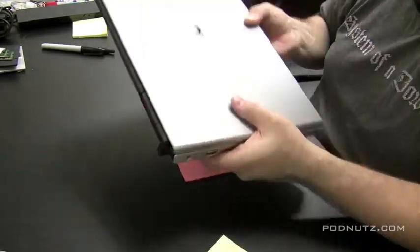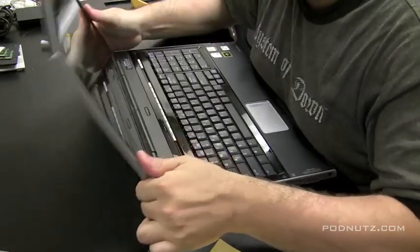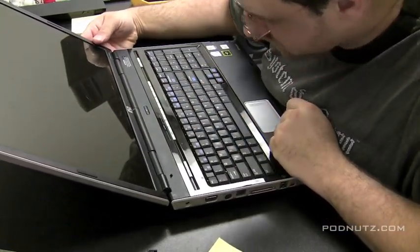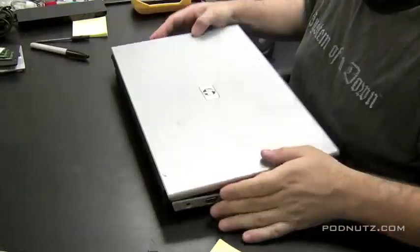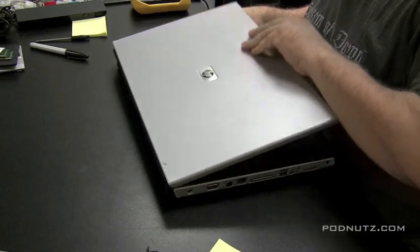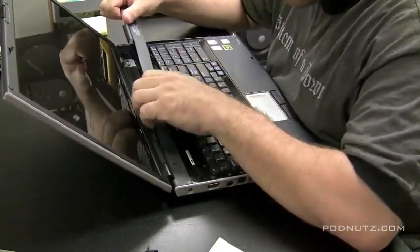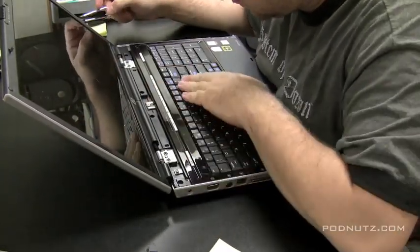Okay, it looks like that's all the screws. Let's flip it over now, and we're going to attack this from the top. That hinge cover should come off, and that is how you get the keyboard off on most systems. Let's see what happens on this system. See if there's any screws in the back holding it in. Nope. So, we're going to take a screwdriver and try to pry off that hinge cover plate — see if it comes off. Do not force it. And it does come off, so that's a help to us. Now we have some screws exposed that will take the screen off and hopefully get the keyboard off for us.